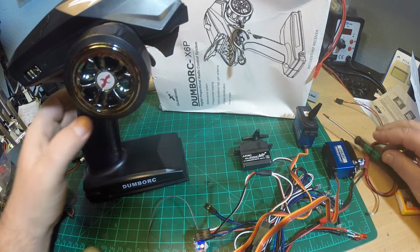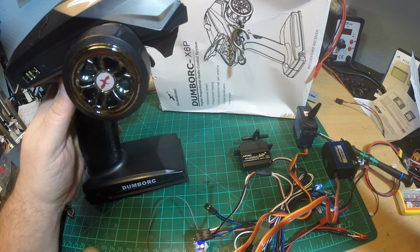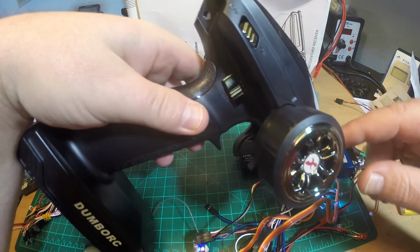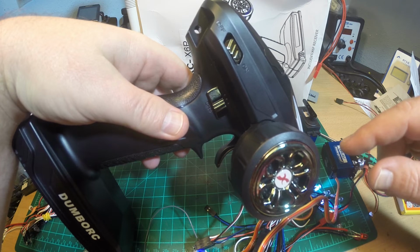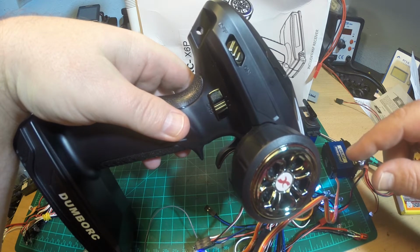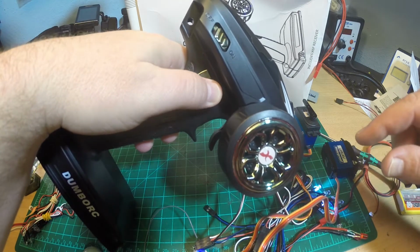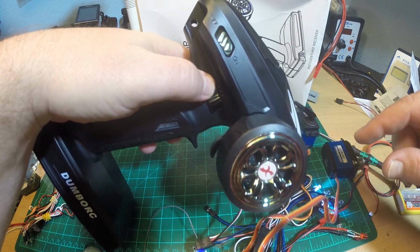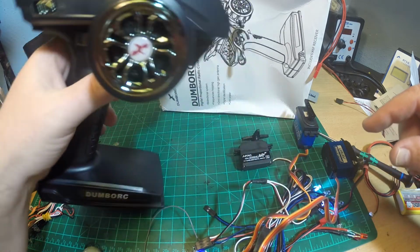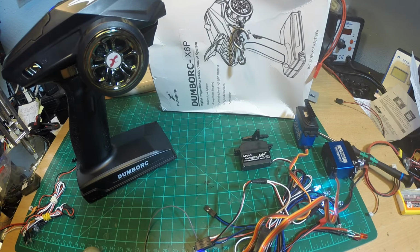Quite a funny thing, but that doesn't help a lot because you would have to have the three position switch always in center position for your winch in neutral position, and when you switch off the lights, the winch will go to one direction and then it will go to the other direction, so you lose the on-off function of your lights and of the light controller.